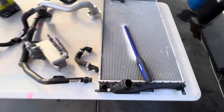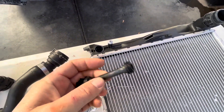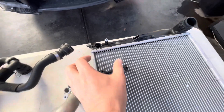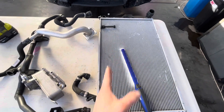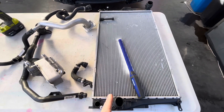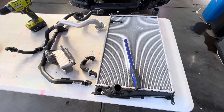On this side, it actually has a separate branch that partitions off part of the radiator, and on the other side it's the same — there's also a partition there. The drain plug sort of proves it, in that it has this long shaft with a seal, and that seal goes up through the base and seals off. It's about seven of the 49 tubes that are in this partitioned-off section — looks like six or seven at this end and about eight or nine at that end.